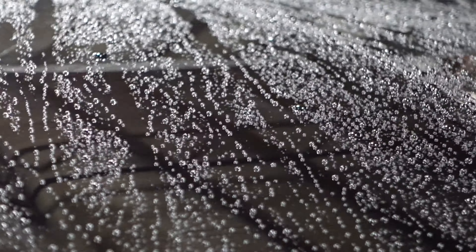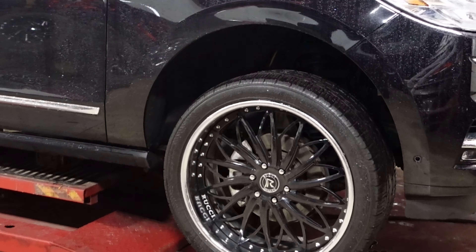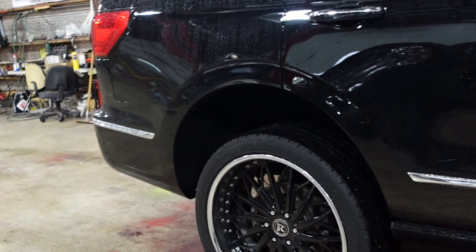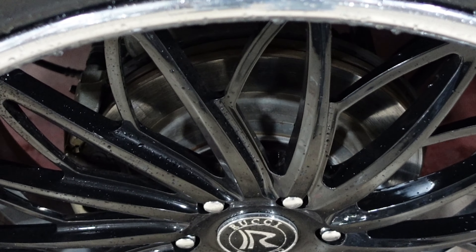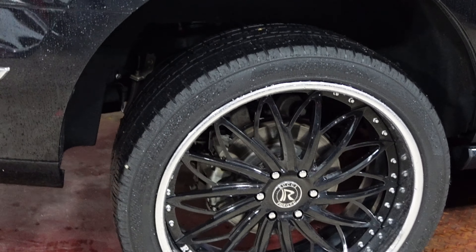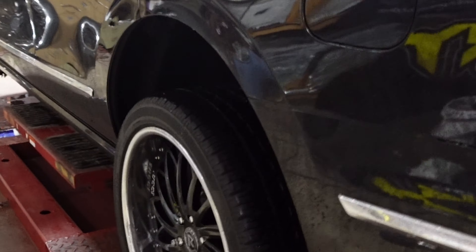All right, so we're back with another video. On today's agenda we have back the Lincoln Navigator. And we do have it back with the Ruccis. So on these Ruccis, they actually cut the wheels wrong and the hub sticks out in the back. So we put a regular spacer inside there. We now have to do a hub-centric spacer because the customer is having issues with vibration. I'm going to show you how the spacer works — we'll take one off. Stay tuned. I'm going to show you what causes the vibration and go from there.